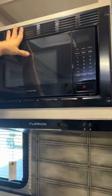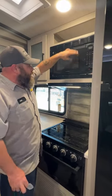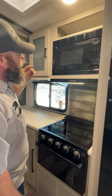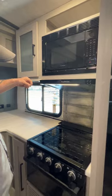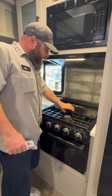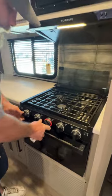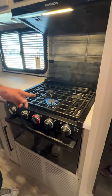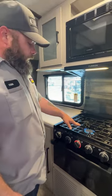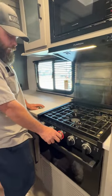Next, we're going to have the microwave. Pretty much it's self-explanatory — we like to say set the time. If you come back and you see the time isn't set on the microwave, it shows there was a power failure at the campsite. You want to look and see if that was from the campsite itself or from the electric company in the area. Then next, we're going to have our stove. This guy will tri-fold open — this is not a glass stovetop. You're going to turn it, it lights up red showing it's in use, and then you'll spark ignite. It sparked pretty easily because I already have propane flow going through the lines. It should die down because I did shut the tank off — about 8 to 10 seconds there, and it's shut off on its own.